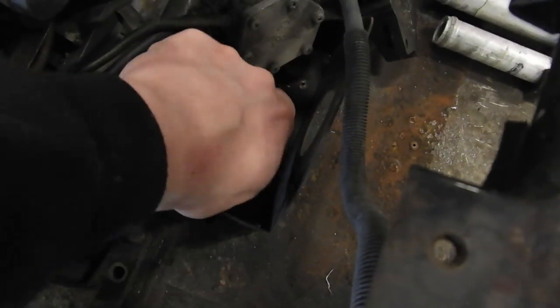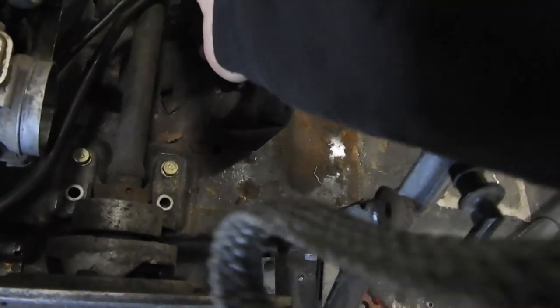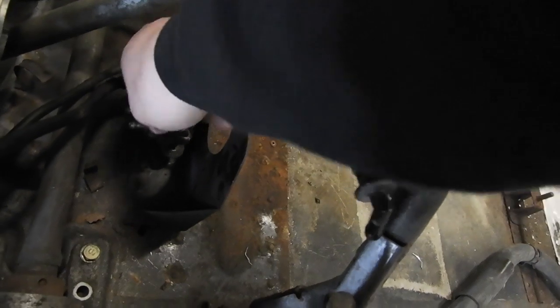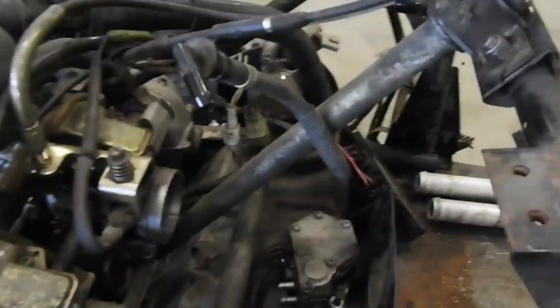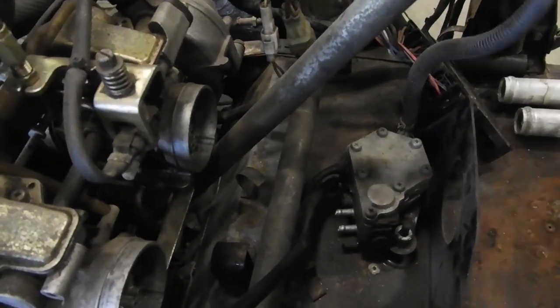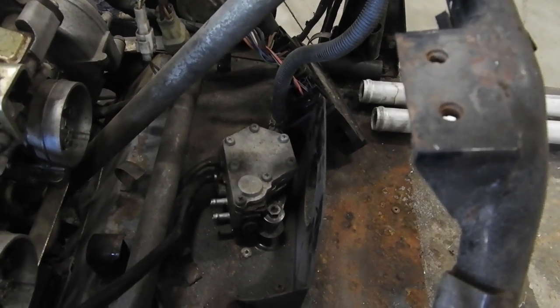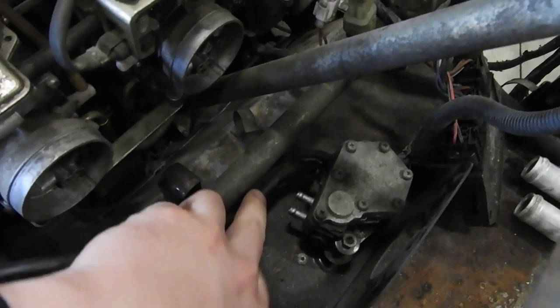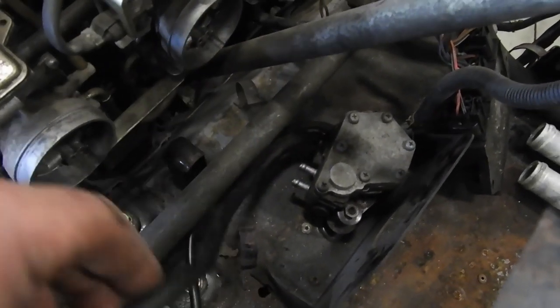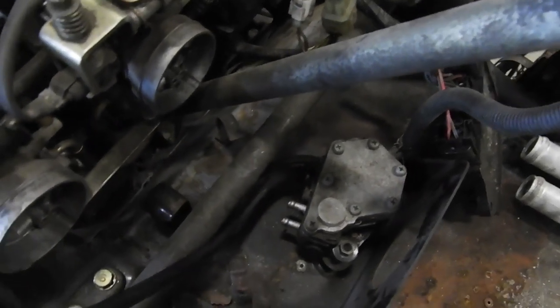It does fit! Okay, there's a little space here, we can leave that on. That's almost too easy. I'll just have to route that in line. I'll have to get these clips all folded back around so my fuel lines aren't in the way. I might have to cut that spacer — the outlets are coming right into the jackshaft, so I think that's what I'll have to do.